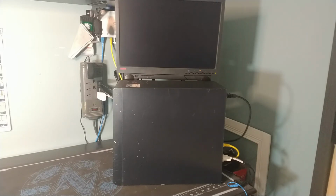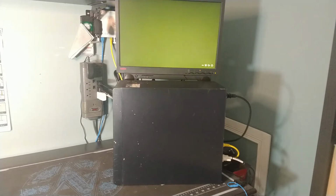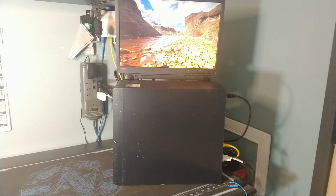And I guess maybe this series of machines was being built reusing some parts coming from the professional workstations or the server division or something. I don't know, where they would have stuck those more powerful fans that are designed to run at full power when you first boot up, in case of emergency, like a server fan does. And then once everything is up and running, the BIOS or the system chipset controller says, no, we're okay, you can run at a lower speed and I'll speed you up when we get too hot.